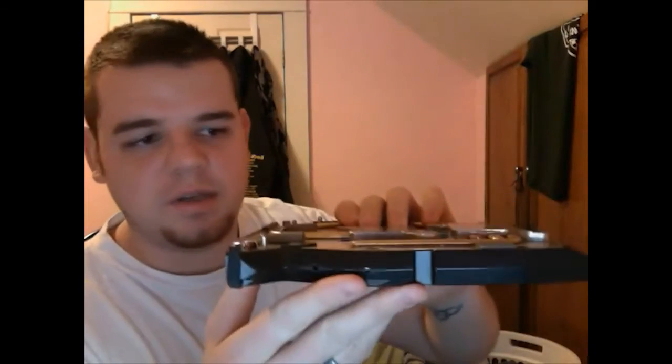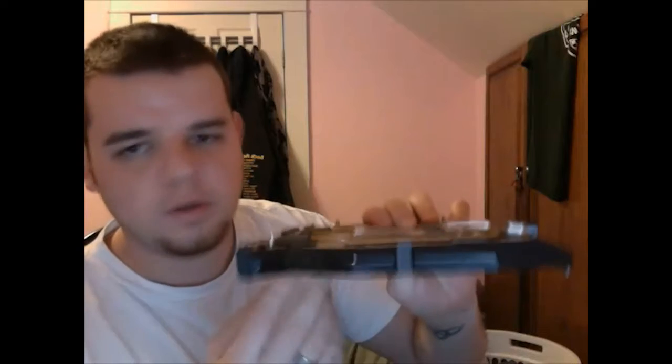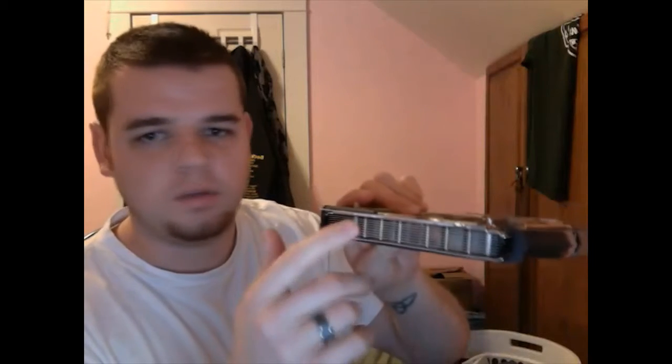I even went one step further and drilled just two holes right on the heat sink. The heat sink sits inside the PlayStation, the fan sits inside upside down, and the motherboard is on top. Those two extra holes help it pull in more air and push out a little bit more hot air.